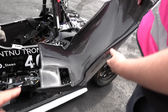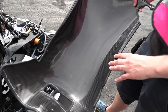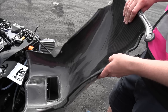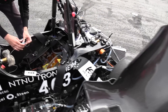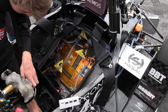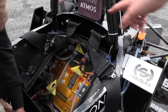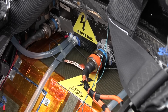So we've taken off the seat now. This is the seat and it's what's in front of the battery pack, or accumulator as we call it. The seat is made from carbon fiber and also acts as a firewall — it's Kevlar and aluminum, which act as the firewall, basically protecting the driver from an eventual fire. Here we can see the battery pack — the lower one, the green one. The inverter is placed above it, where you can see the water running into the inverter. The accumulator feeds the inverter, which then feeds the four motors.